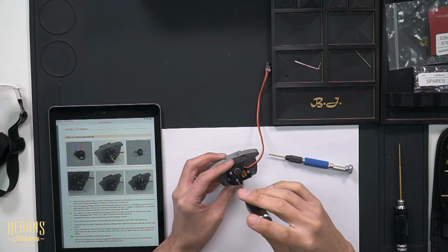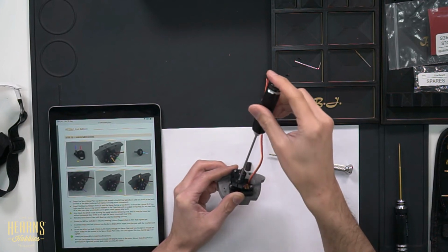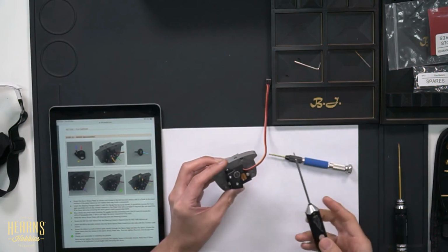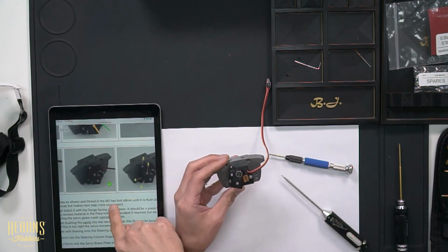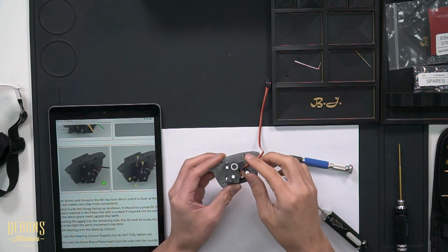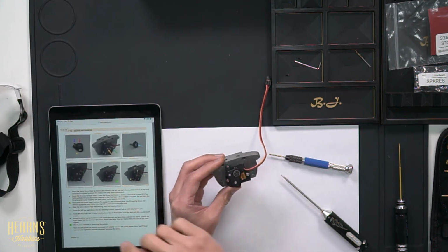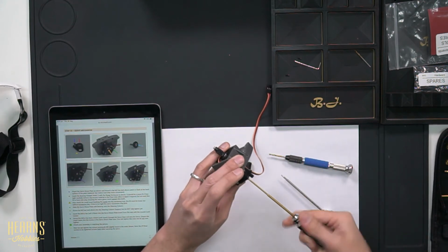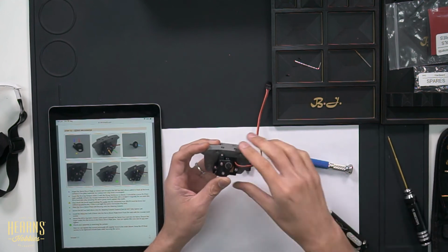Okay, so the insert is sitting into the servo brake plate, so tighten it up but not too tight. Sort of finger tight there. Check that everything matches the photos. Looks all pretty good. Which means if we're happy with it, we will tighten this all up here. Alright, let's bang that together. Alright, nice and tight.